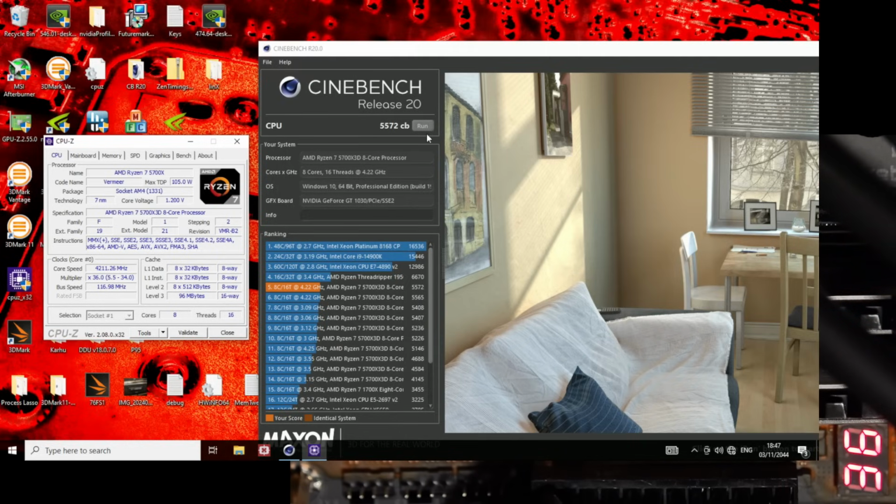You might be wondering, why am I using a B550 motherboard? Well, that's very simple. X570 motherboards do not support BCLK overclocking in my experience. You raise the BCLK on an X570 motherboard by more than like a megahertz, and the chipset just checks out and the motherboard refuses to post. So if you're going to mess around with BCLK overclocking, you want a B550 or an A520 motherboard. I'm serious about that. A520 motherboards generally have better BCLK overclocking support than X570 boards, though those have issues in other ways.